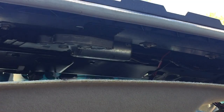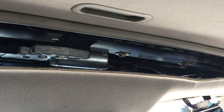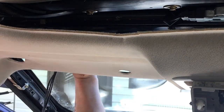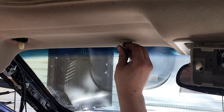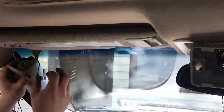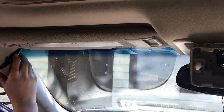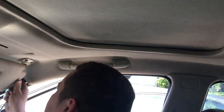After I was done doing that, I ended up tying the wiring into the harness that was provided, then soldered the connections to make sure they're nice and solid. Electrical taped them and put them up out of the way. I go here and put it all back through, running it down the pillar to hide it and tuck it all out of the way. Basically at this point you're just reassembling everything the way you took it out, but this time you're adding the wiring and hiding it — making sure it's not visible because you don't want a tacky looking interior with wires hanging out everywhere.